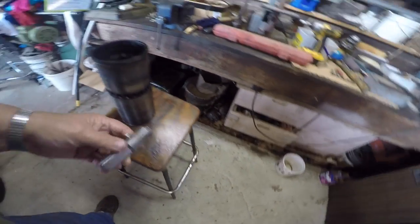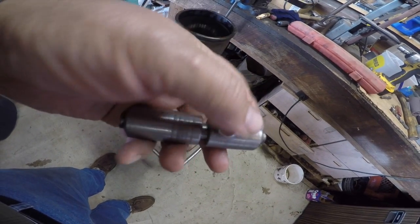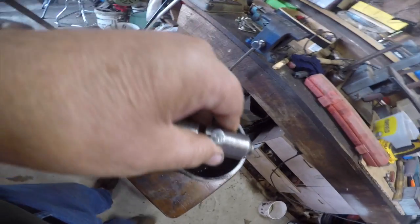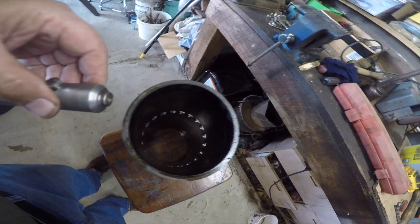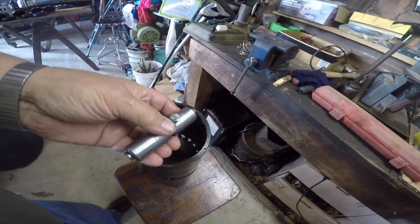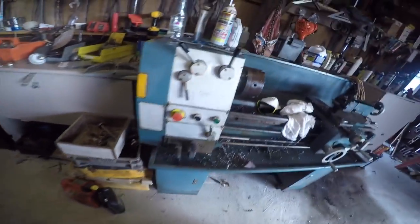Here's a little tool I made — it's spring-loaded, there's a spring in there. You just sit this down in the liner, run the piston all the way down, set that down in the liner, then loosen the screw and let it pop into these holes. When you turn the motor and raise the piston up, it just brings that liner up out of there. It works real good. I started to film it happening but I was afraid the thing wouldn't work, so I didn't — but I should have.